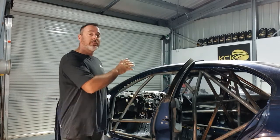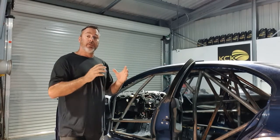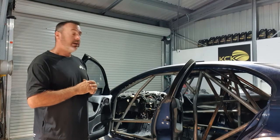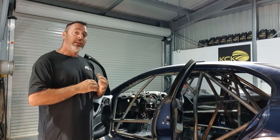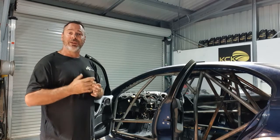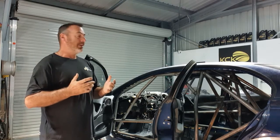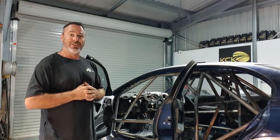So we'll get the complete roll cage assembly finished inside the car and then weld the footings to the floor. But before we can weld on the floor, we need to get rid of the body deadeners. There's a whole heap of body deadener in there — it's probably worth about 20 kilos, well worth the effort to get it out. We've got some dry ice coming this morning — that's by far the neatest and easiest way to get that stuff out. We used to give the job to the apprentices with a heat gun and a scraper and throw them in there for a day, but no apprentices here today, so dry ice it is. We'll keep cracking and get this cage finished up.